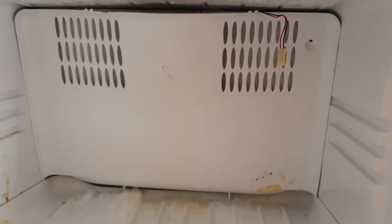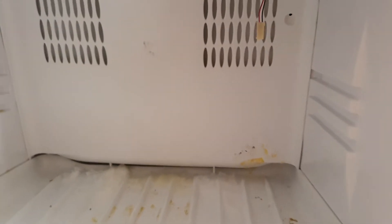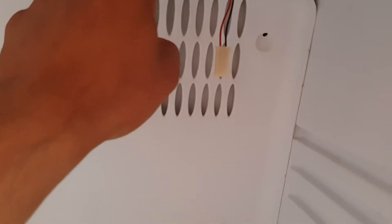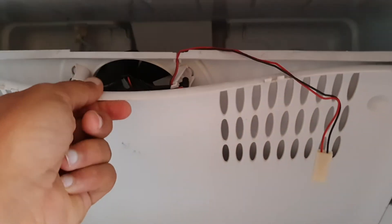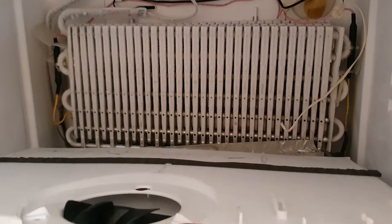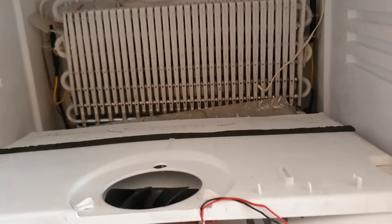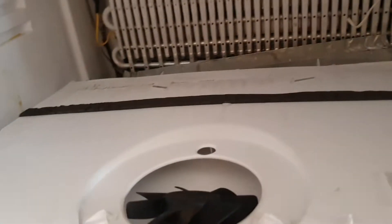This is the typical freezer section you'd see in the E-series fridges. What you're going to do is use a screwdriver to bring these hooks down, then use a plier to pull this out. It's a fairly moderate repair — you don't need an extreme or advanced skill set, just be careful not to damage anything. It's fairly straightforward.